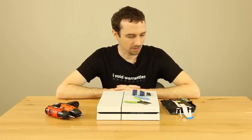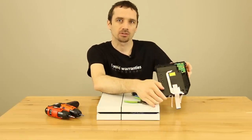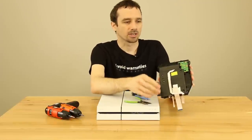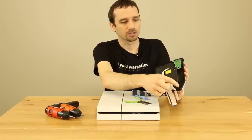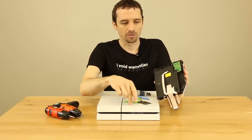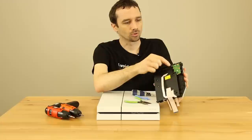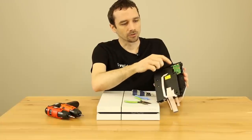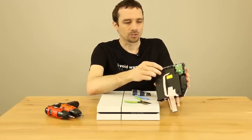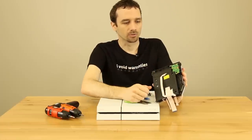What we're going to be doing today is swap out the disk drive. This is another disk drive we have for it right here. The reason for this is because on these newer disk drives, there's no big green board. On the older models, this green board had a chip that was married to the motherboard. This model does not have that chip — it just has this small board with the eject button on it. So you can just swap out the drive without changing anything on the board since it's not there.